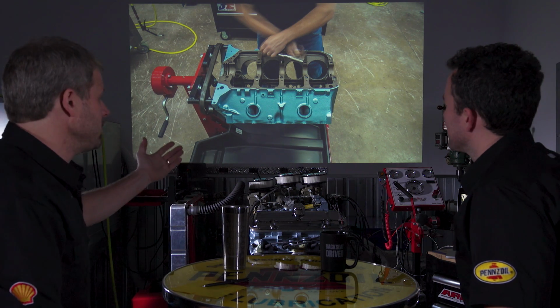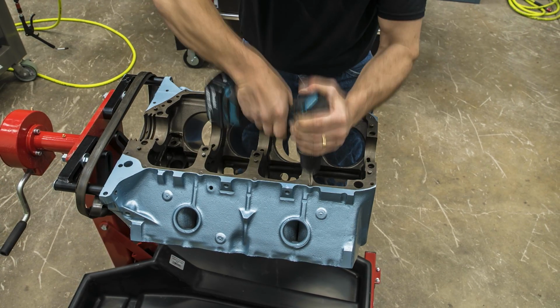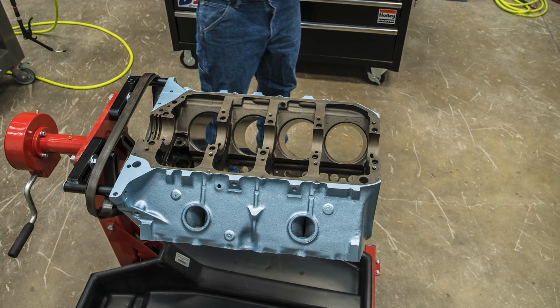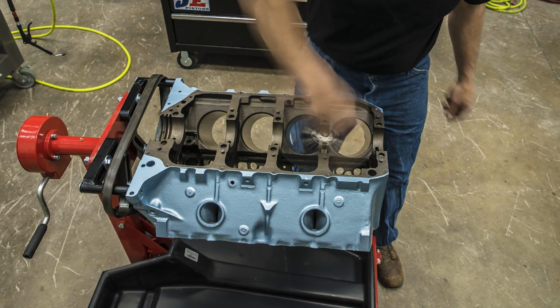And the other part of it is when we go through and assemble, we use torque wrenches. We use torque wrenches for the reason of getting a consistent clamp load relative to whatever the specification is. So you're always looking for clamp load, because torque is only equal to that clamp load when friction is a constant.